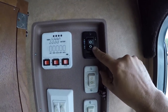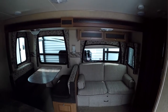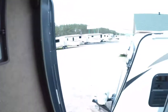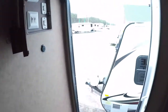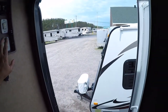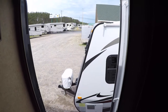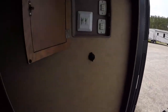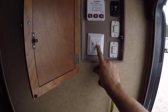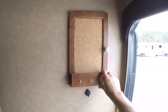You have your power awning button — in and out. You have your two slides: the top one is for that slide, and then the other slide in and out is your kitchen slide. Make sure when you're operating these, the slides go all the way out to create a seal, or all the way in — never use them when they're halfway. When they're out, you'll hear that clicking sound, which means it's all the way out. You also have two light switches — one for your outside lights and one for your inside lights. That's behind that little door there.